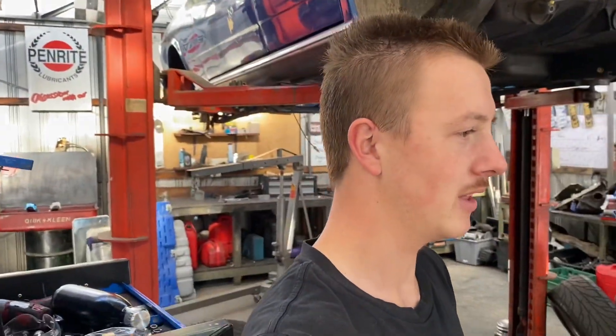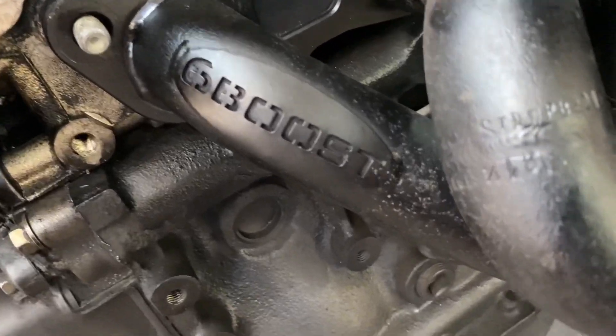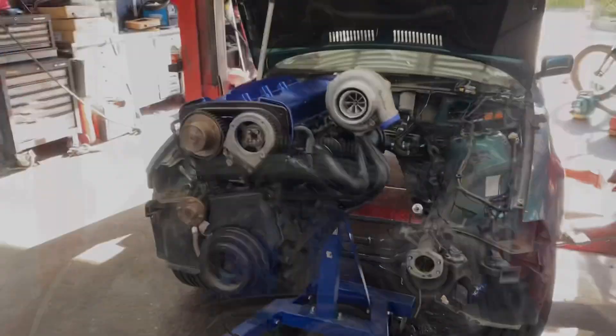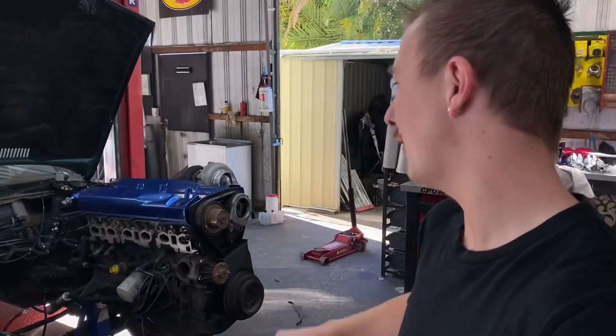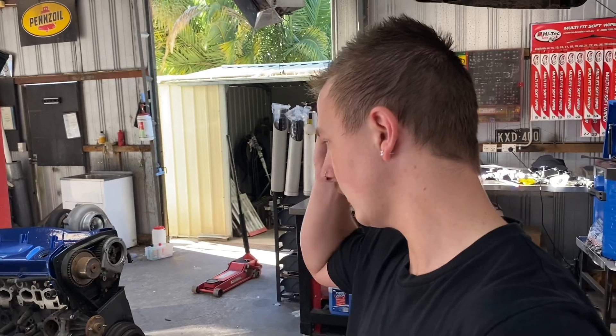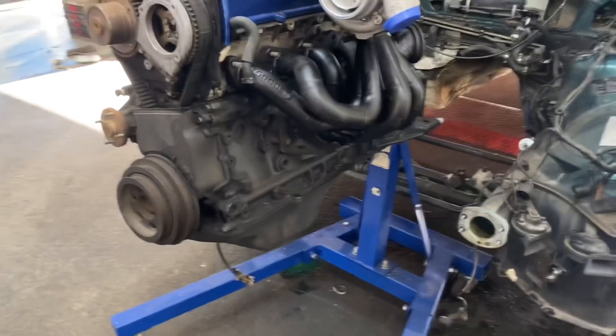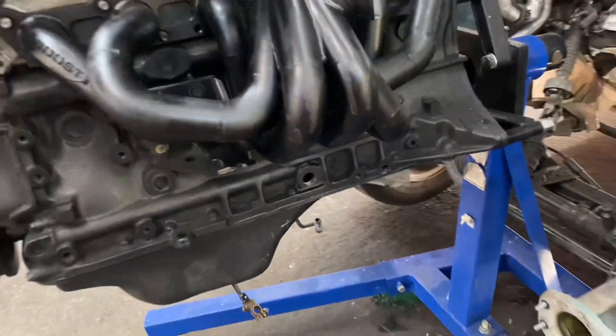Here's the big reveal. Got the engine right here on the stand. I've done a few things to it. I think it was pretty obvious what I was going to do. I've had this motor sitting for a while — bought it when I first got my sedan, because I was going to pull the RB25 out of that and put this in it. This is a RB25DE Neo out of an R34. A bit higher compression, solid head. They still have VCT but it's internal rather than external like your typical Series 1 or Series 2 motors. The block has been drilled and tapped for a turbo drain.